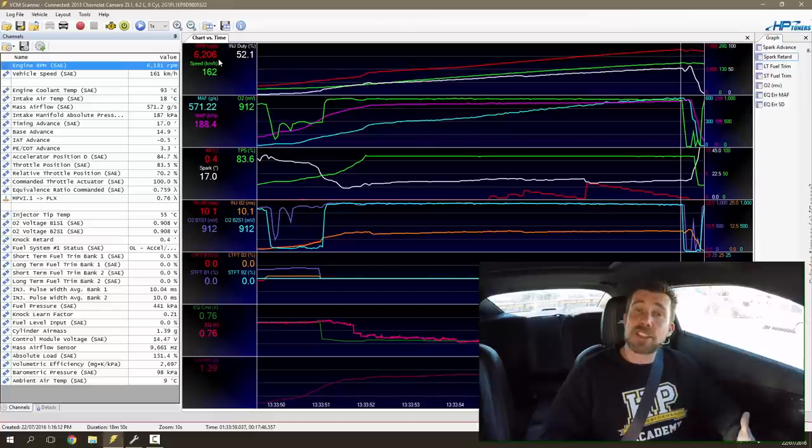Here I'm doing my tuning on a closed racetrack so I don't need to worry about breaking any speed limits. However if you're doing your tuning on the road, this should be a serious consideration. The other aspect of choosing our gear is that if we're tuning a powerful car like this supercharged 6.2 litre V8, choosing a gear that's too low - perhaps first or second - we're going to end up with problems from wheel spin. The data we've got on our scanner here is essentially the same as what we performed on the dyno.